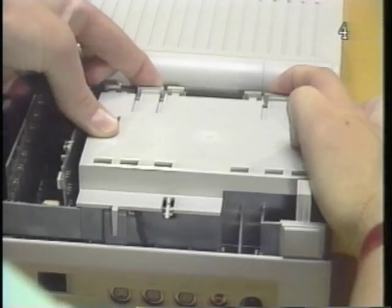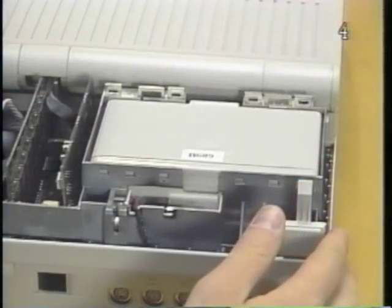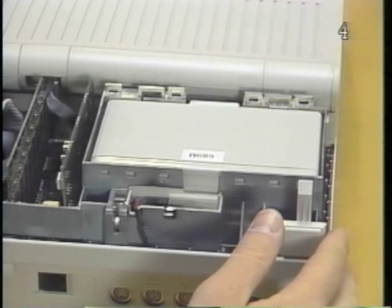When this cover is removed, the battery is turned off. To the rear of the main battery is the 9-volt backup battery. When the main battery cover is removed, this 9-volt battery is used for backup power. The backup battery saves data stored in RAM and parameter RAM. This battery is not powerful enough to operate the Macintosh Portable and should only be used for a very brief period of time.